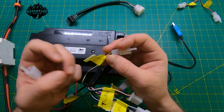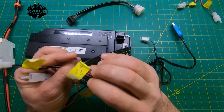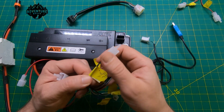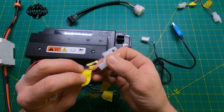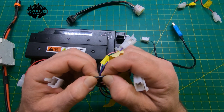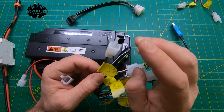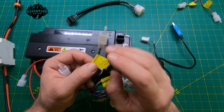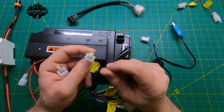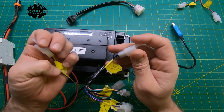This next one is the low brake. High brake takes 12 volts — don't use full battery pack voltage on it. Low brake is a ground signal: the black wire and then the brownish-gray stripe wire. If you hook that to ground it's the same as putting 12 volts to the high brake — it just pulls the reference low. If you want a simple brake switch or dead-man safety switch, hook it here. Connecting these two together kills the motor.